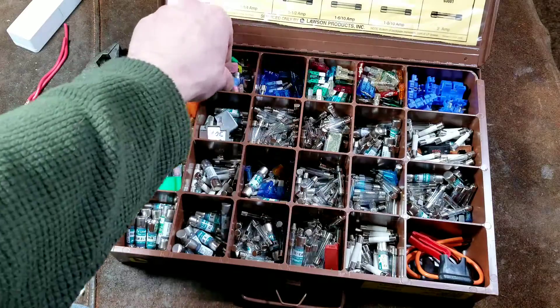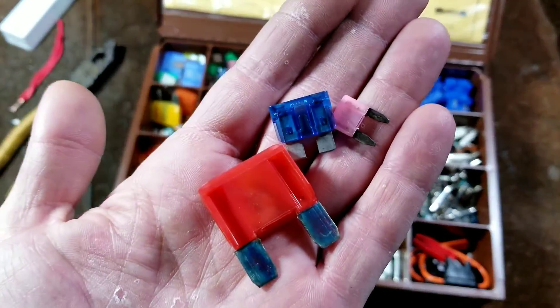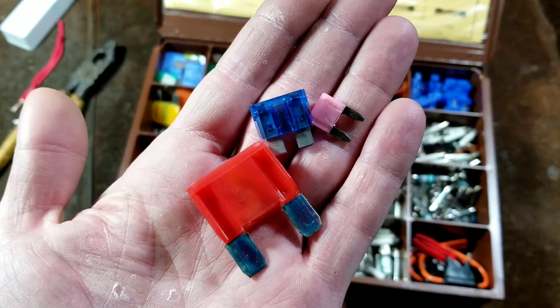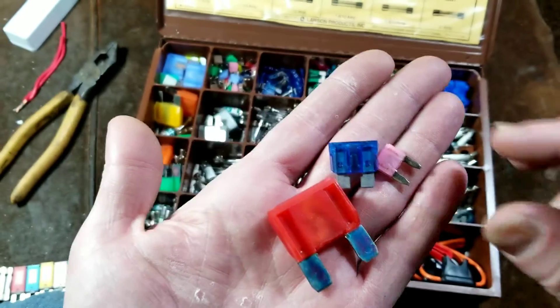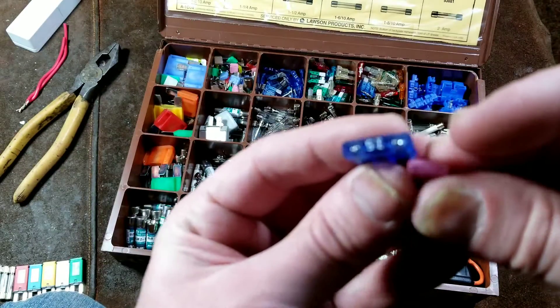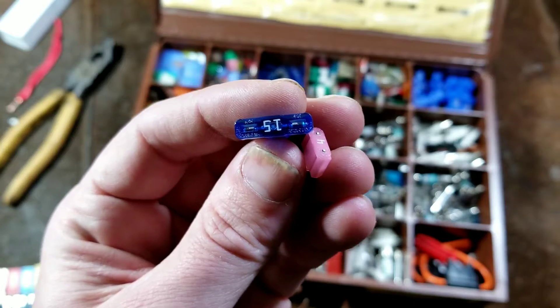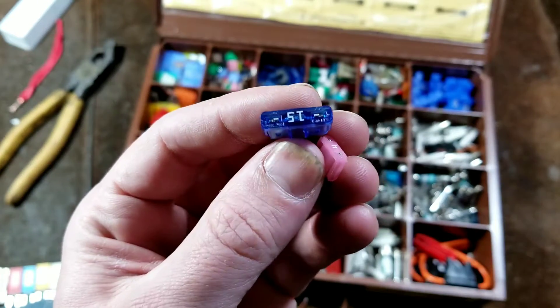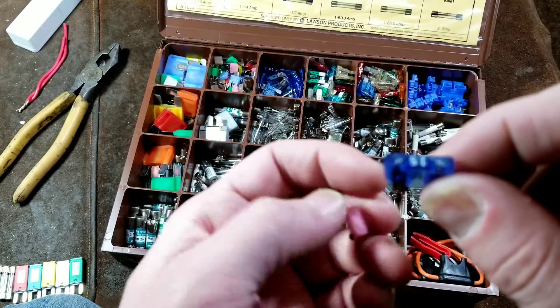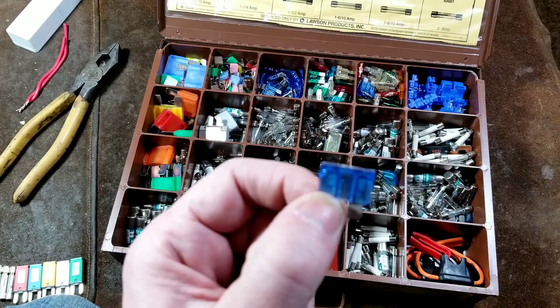There are, of course, automotive blade fuses, and many people are familiar with these. There are a few other styles, such as big square plug-in ones. These blade fuses are the most commonly replaced because they're used in many other applications besides automobiles — everything from power inverters to car stereo amplifiers usually use this mid-size, three-quarter-inch blade fuse. They come in a variety of amperages, usually stopping at around 30 to 40 amps.